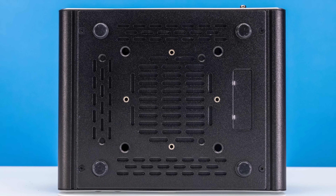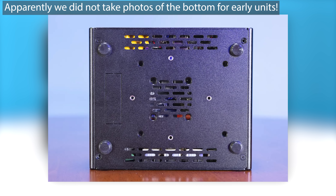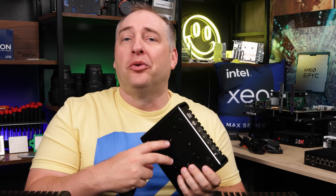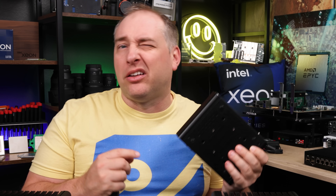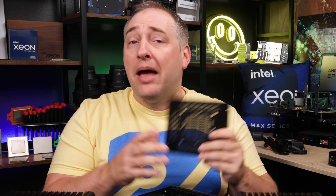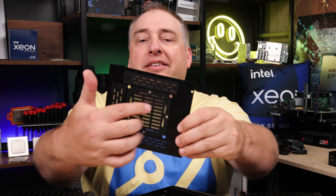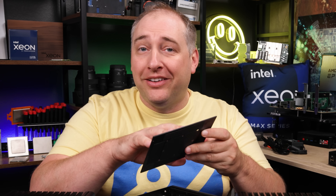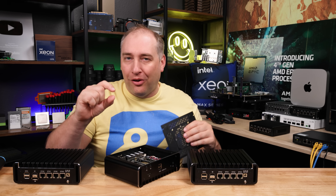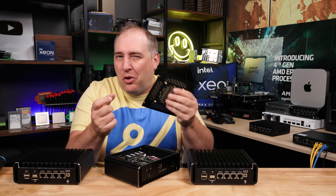On the bottom you'll see the newer design with vents. If you go back in the STH archive, these units used to be kind of flat with no bottom venting, which meant you didn't get enough cooling. That transition happened about a year ago. Getting inside the system requires four screws and the bottom panel lifts right off. One nice touch: there's now a little mesh covering the vent holes — it used to just be giant gaping holes, but this is one of those small quality improvements we're seeing each generation.